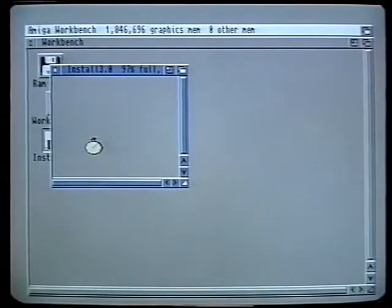Now that we've established just how useful a hard drive can be, the next question you should ask yourself is what type of hard drive you need. Don't make the mistake of assuming that all hard drives are the same. Just because a hard drive appeared to work inside your friend's PC compatible, or indeed inside another model of Amiga, that doesn't necessarily mean that the drive will be suitable for use within your A1200. Just like the A600, the A1200 features what is known as an IDE hard drive controller, which is built into the machine's complex electronics.